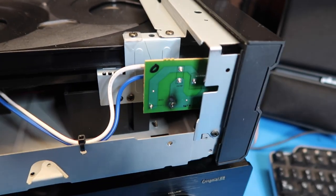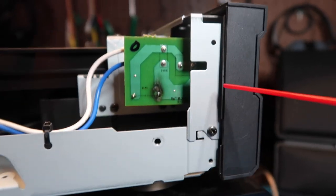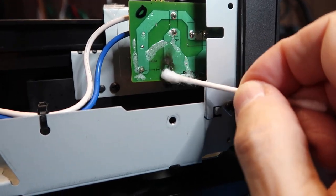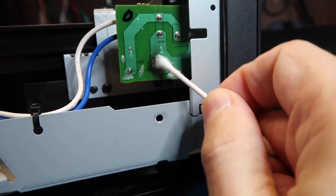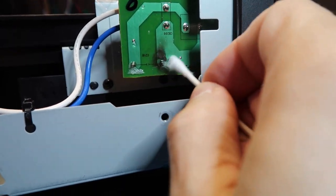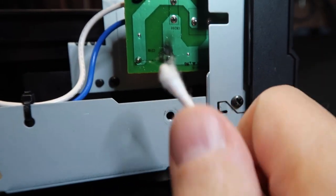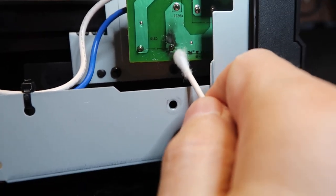I'm going to see if I can clean this off with some solvent, with it unplugged of course. I'm going to squirt a little tuner cleaner — this is ancient stuff but it's similar to DeoxIT that's available nowadays. That black stuff isn't going to come off of there, but likewise I don't think any real damage was done. It's just cosmetic since it's internal to the unit. We evidently shorted this capacitor here.